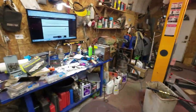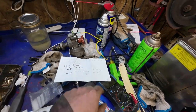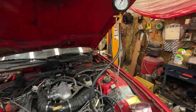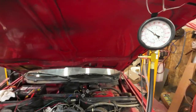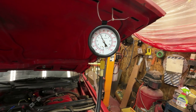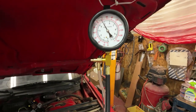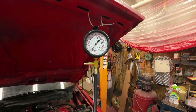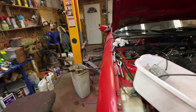Yeah, there, I've been working all afternoon to achieve 1.2 bar, 1.25 or something like that, which is the amount that I want for a cold start, between 1 and 1.5, right? So 1.25, that's good enough. Seems to be pretty steady there. If I turn on the thing to go up to there, yeah, and then that's the operating pressure or whatever they call it. And it comes back to 1.2, 1.25, right on.